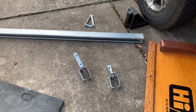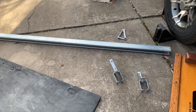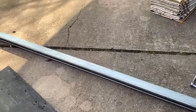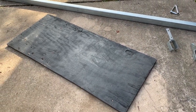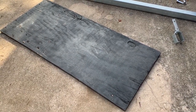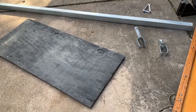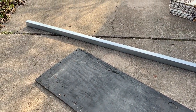The two brackets were about $17 a piece plus tax. I'll cut it to a little over 6 feet, just enough to put it into those channel brackets. Additionally, on top of the box rail — you can see it's flat on top — I've got some 3-quarter-inch plywood so that the bottom of the water tank isn't sitting strictly on the channel. I'm going to put this plywood on top of the channel, and possibly a piece of 3-quarter and then another piece of half-inch across there. Let me get to work on this and I'll come back and show you how it came out.